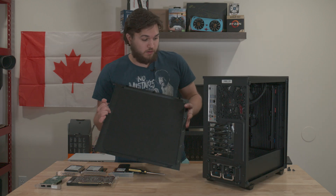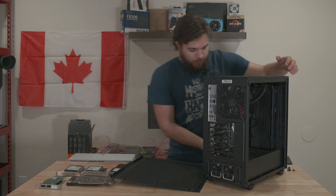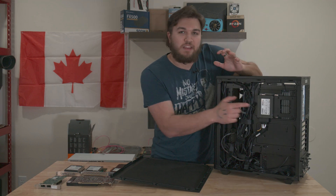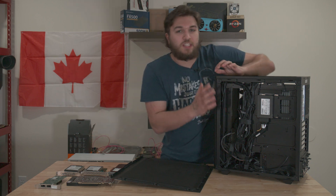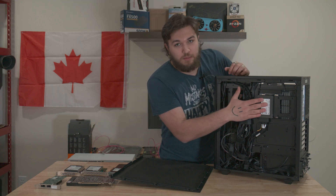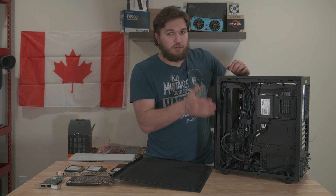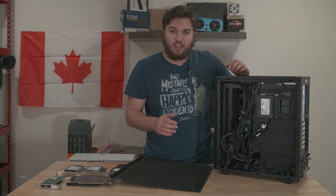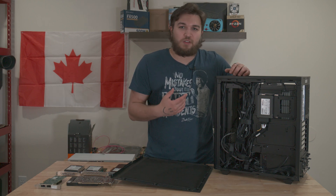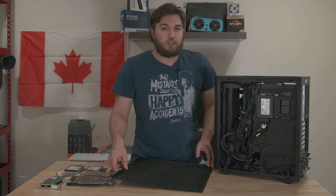You may have to forgive my cable management here. Good thing I opened this back panel because my drive came disconnected. In the back we have our boot drive — this is the DC 1500M from Kingston. It's a 960-gigabyte U.2 NVMe SSD with four PCIe 3.0 lanes — enterprise-grade and in a U.2 server form factor. It's been chugging along, gets over a gigabyte per second sustained, and Kingston sent it over a while ago. It's just a great boot drive and I trust it, so that's why it's the boot drive for this NAS. It'll also be used to store files I really don't want to lose since it's one of my highest quality drives.